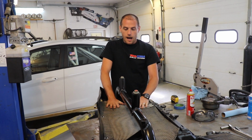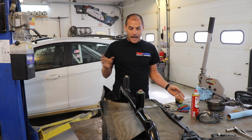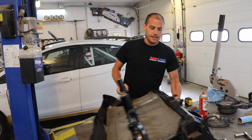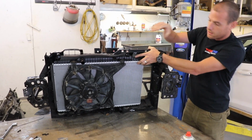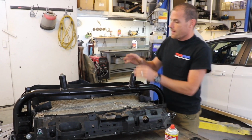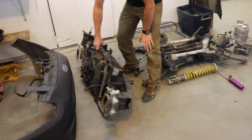Get a good heavy duty wire mesh like this over the radiator. One other thing you can see that we do here, and I'd recommend highly that you do yourself as well, is kind of just the modularity of this. So this whole radiator shroud, this front piece that bolts to the front frame rails, your cooling fan, this push bar on the front that protects everything that we make, that your light bar bolts onto, this all comes off of the car with just a few bolts off the frame rail. There's another one on the ground here. So you can see why we do this.